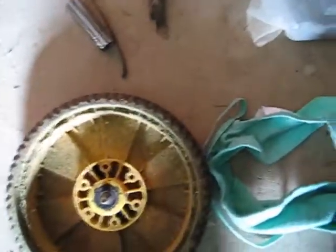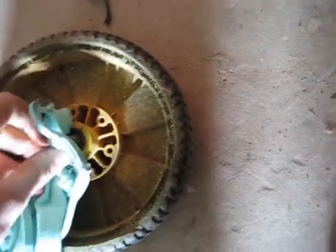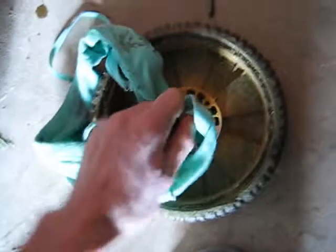I'll put this washer on, get a bit of a clean. These are the ball bearings, by the way. I'd say that bearing's okay — the seal's not blown or anything. It spins pretty good on its own. You put your finger on it and you turn — you should feel if it's good or not. In this case they were all ready, both back ones. I did that test with them and they were good, so that's a good sign. Don't have to be replaced — get them clean.